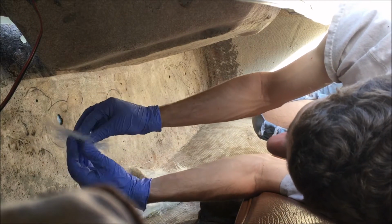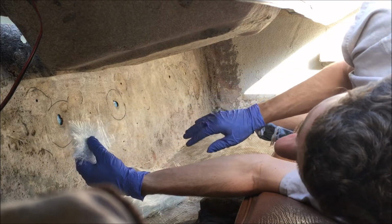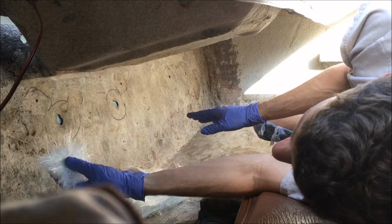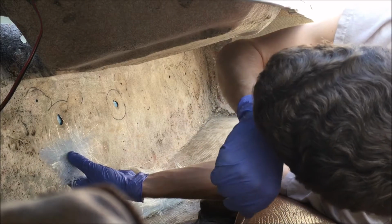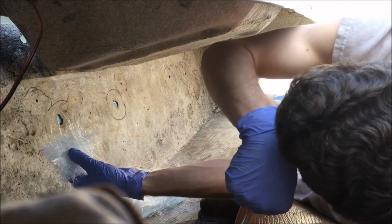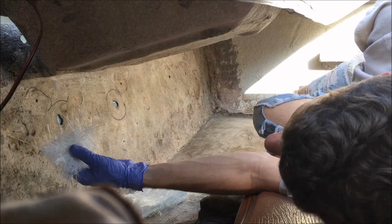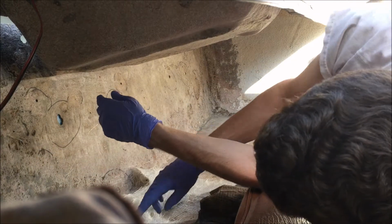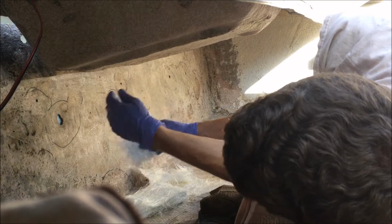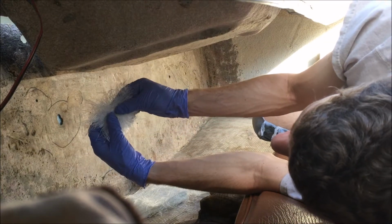But you just want to make sure you get all your fiberglass pieces ripped out and have them laid out so you know where they go, so that once you mix up your resin, you're not looking for anything and wasting time, because that stuff will kick on you real hard, especially where I live in Florida. It's probably about 80 degrees right now, and even if I mix it pretty slow, it's still going to kick off fast. I'm only going to have about 20 minutes of working time maybe. So you want to make sure you have everything ready to go before you mix your resin up. So I'm going to go ahead and rip up the rest of my pieces, and we'll mix up some resin.